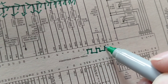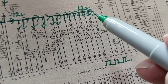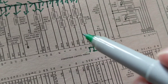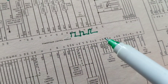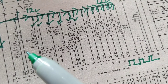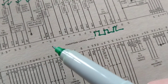You need a scope to see pulse width modulation, but anyway it doesn't matter. The first thing: if B plus is here, right away the thought comes to mind — the other side needs a ground, something has to give it a ground or control it on and off. What does that? The computer. The other sides of all these valves and sensors go to the computer, and these are the pins that it goes to.